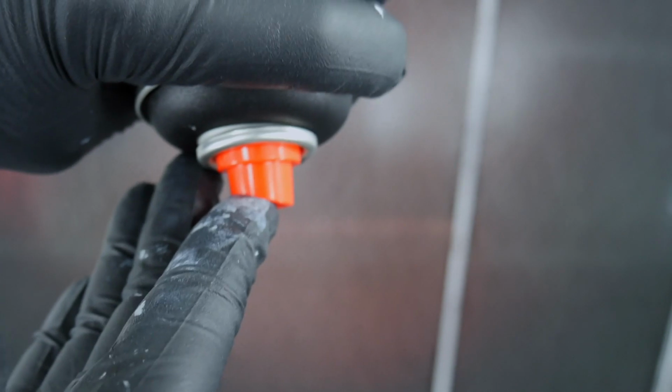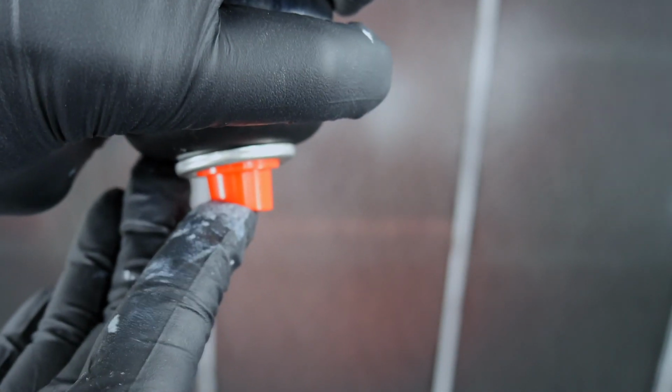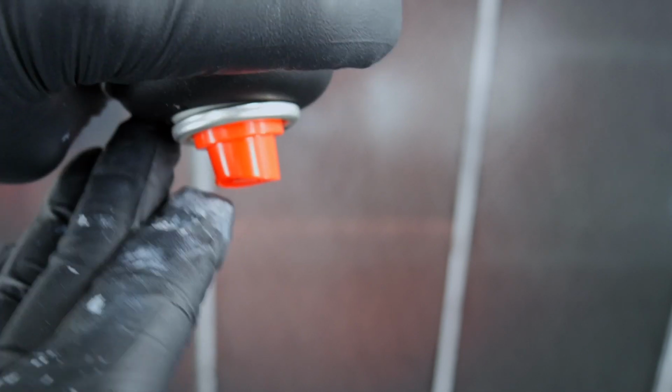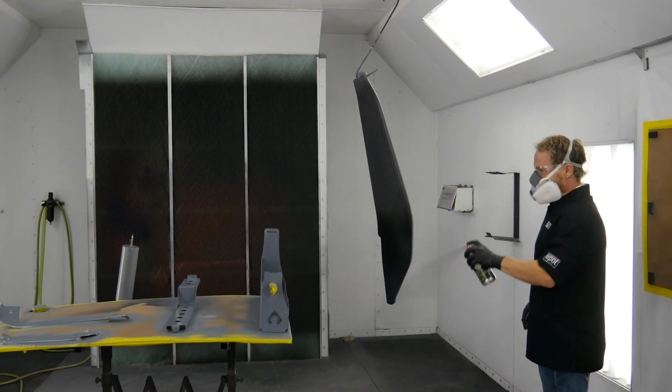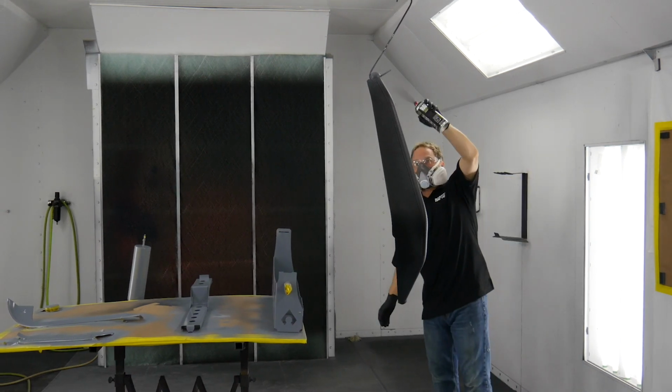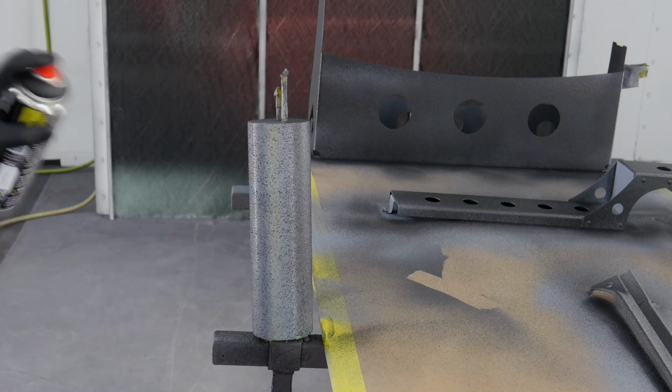Remember to invert the can and clean it out between coats. This will avoid any product hardening in the dip tube. Raptor aerosol will dry to touch in less than an hour at around 70 degrees Fahrenheit, and it can be put back into service after drying overnight, but allow at least 3 days before exposing Raptor to water.